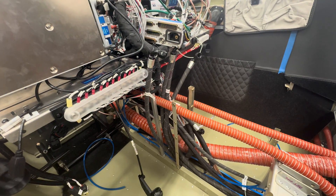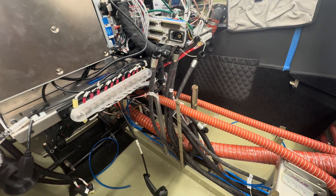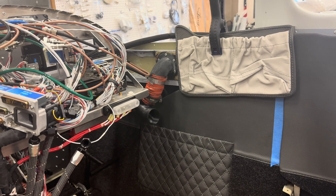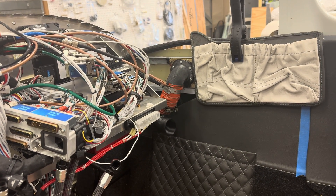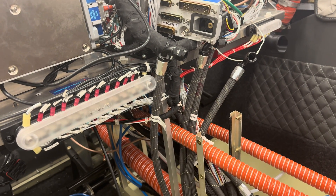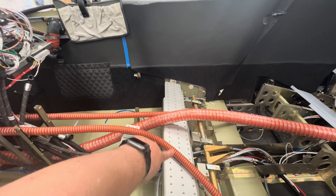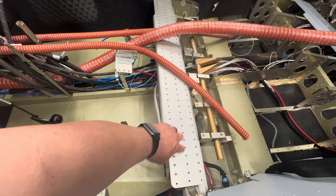I've run the heater lines. I've talked about it in several videos about how I'm doing my heater lines — a variation of what Evan has shown in some of his videos. I have one going down the channel to the back that'll come out over here where I'll have an Aveo maxi vent. And then the other one will connect to the glare shield vent mount with another Aveo maxi vent. Then I've got a two-inch being split into two one-inch that'll come to the back here and run down the wings through the wing spar carry-through.